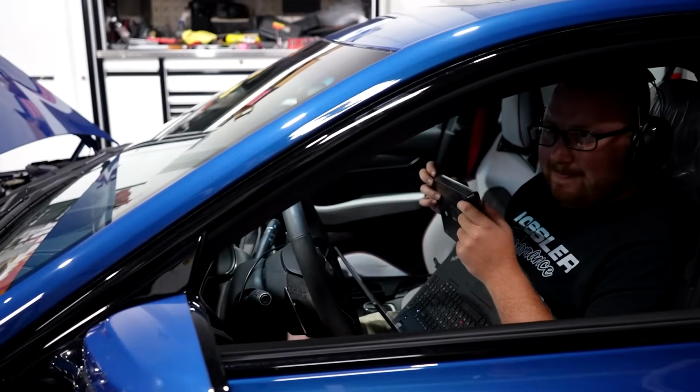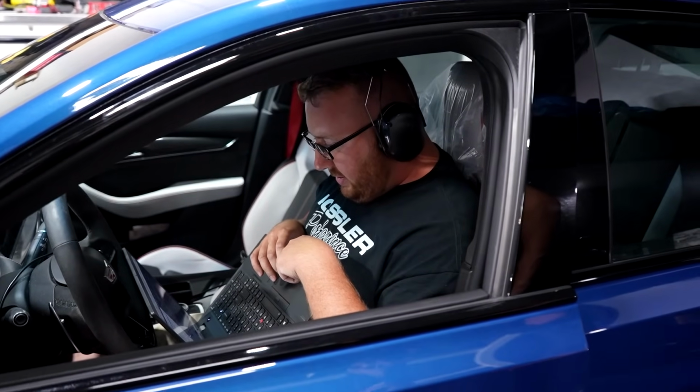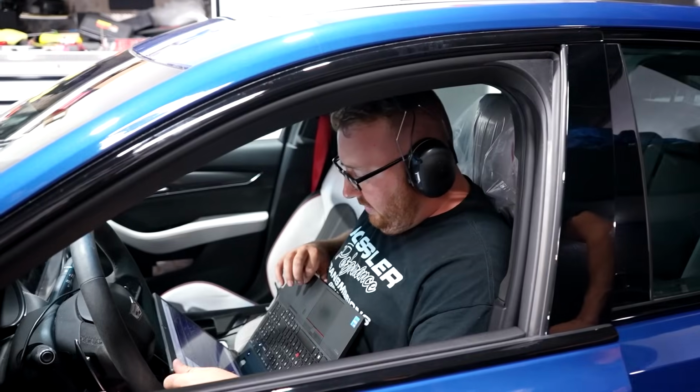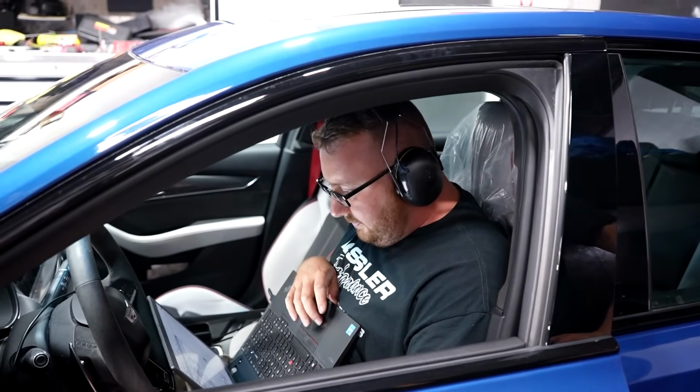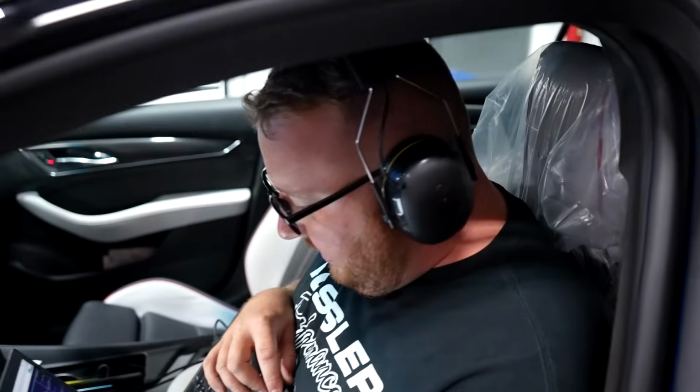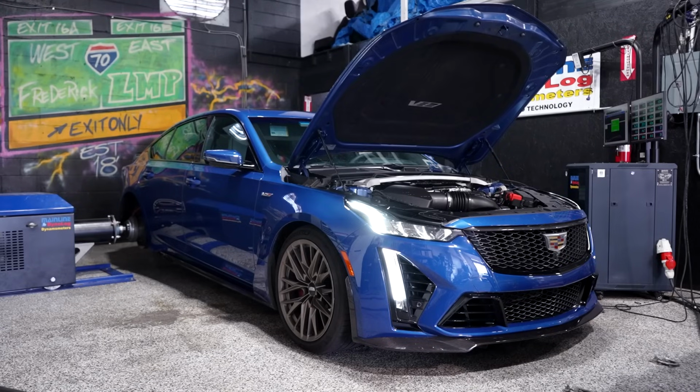Yeah, interesting. Alright, so you want to touch the fuel up some? Yeah, the trims are a little off. Not a little, but I'll clean it up a little bit. The air-fuel on that is like a half point leaner than the factory. It's like 12.8 on this. I'll probably pay attention to more of this than that, but it's still a little off there.